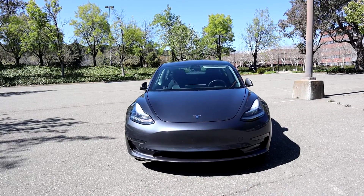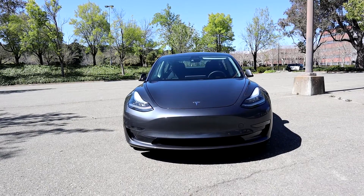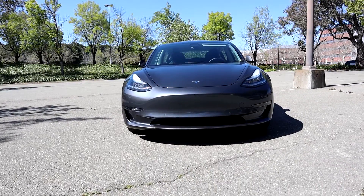I found this decision kind of interesting from Tesla. We know that lithium ion chemistry is kind of the future, and lead acid is really old technology. I think the reason they did that is because lithium ion batteries are pretty expensive, whereas lead acid batteries are pretty cheap, so they probably put lead acid batteries in there as a form of cost savings. And I think this hurts the cars a little bit, because you will hear lots of stories about the 12 volt battery dying — it's pretty much the Achilles heel of a Tesla.